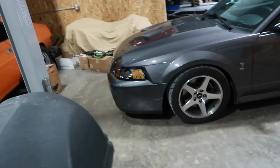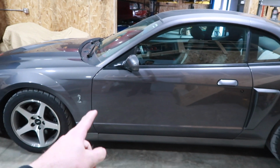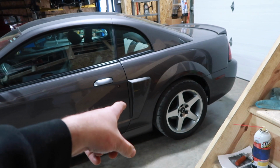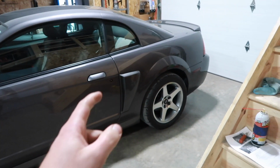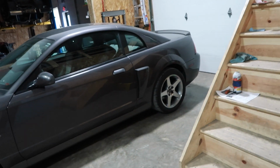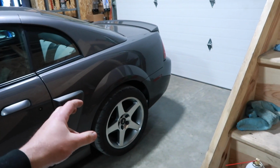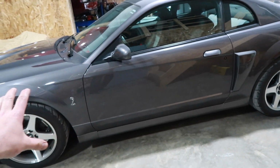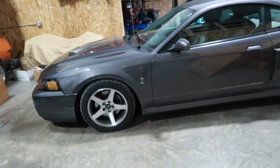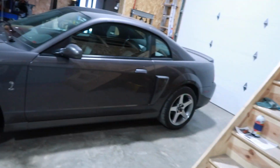Anyway, so the DSG car is done. We put a 26 spline input shaft in, a McLeod RST clutch. We did a full tilt boogie racing rear suspension in the thing. The only thing that we did not put in the rear end is the toe links, and that's because they're out of stock. And cross axis joints because low miles. So the toe links are out of stock. We're going to be getting those on here next time the car's back, because this car is coming back to us for a 3.4 Whipple, 4 Innovations fuel system after he gets the clutch broken in. So we did the clutch and the rear suspension now so he can drive it, get some miles on the clutch, make sure it's broken in.